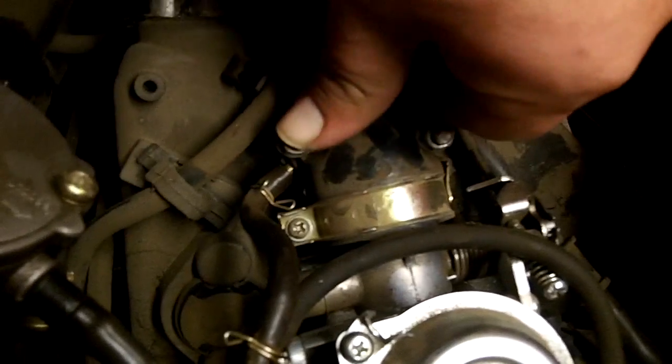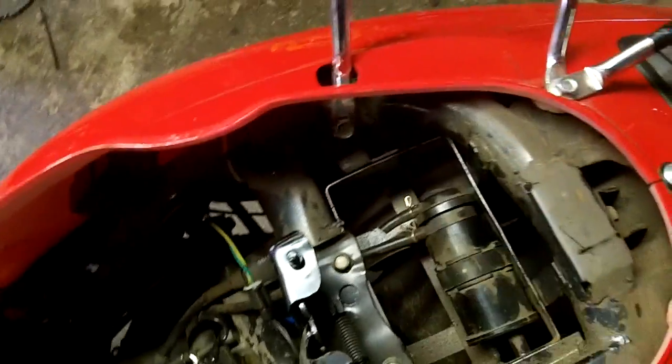Another thing to inspect is your intake. This is a plastic part and a crack, and then you'll have a vacuum leak. Alright, to remove the rack, you need to first remove the hand holds, and then back here there's another brace. Those need to be loosened, and then this should be able to lift off of the body. Once I get that done, then it's about loosening this bolt, loosening these two screws on the side, and then there's two under the bumper, and then the tail light, and then she should just come off.